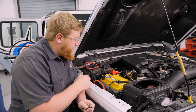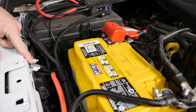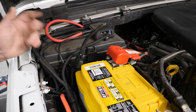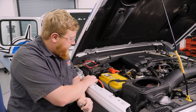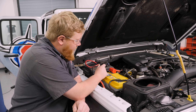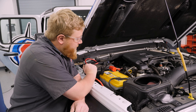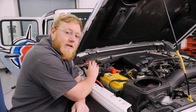When you run these, you want to make sure that you have your power wire here, and your ground wire is going to connect to one of the three studs right here. It's very important that you connect your ground wire to one of these studs and not the battery, or else you're going to lose about six inches of harness and it won't be long enough to route where it needs to go. So we've got our ground wire attached to this ground stud, power wire up here attached to the battery, and I went ahead and pulled the fuse out of the fuse holder so we don't have to worry about any accidental arcing.